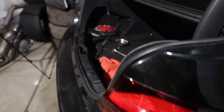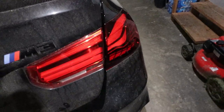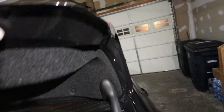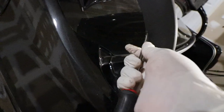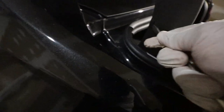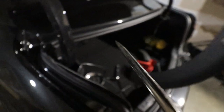Let's go ahead now and work on the inner tail light. If I close it, you can clearly see that these ones are a little darker than the factory one — that's one difference. Now we have to remove this cover, remove the inner side of the tail light, and then hook up the next one. Using your screwdriver, you put it right here and push it in — it's going to release that clip right there. Do the same thing on the bottom, remove that, pull it completely, then pull towards the down, and that one is off.